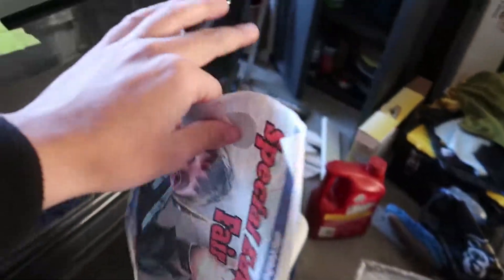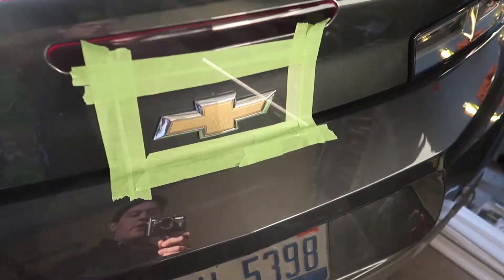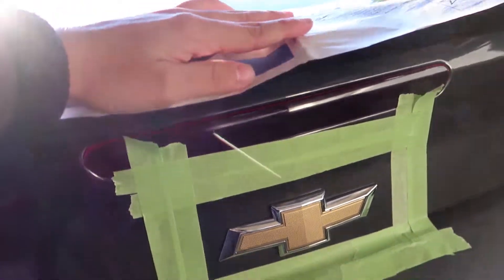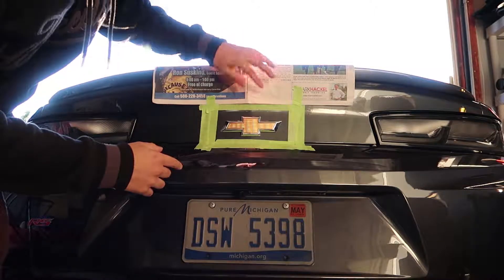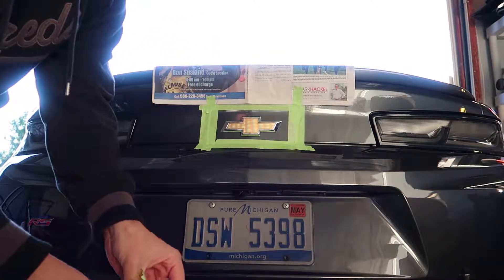So you're just going to take a piece of newspaper to avoid overspray from getting all over your car's paint. Because with Plasti Dip you want to do thick coats so it can peel off easily, and overspray is just a bunch of little dots that will show up everywhere and is very hard to get off. Make sure you cover as much of the car as you can to avoid overspray. Doing this on a non-windy day is probably ideal, but we're going to make it work. Take the first piece of newspaper and put it onto the tape making sure there are no gaps underneath it.